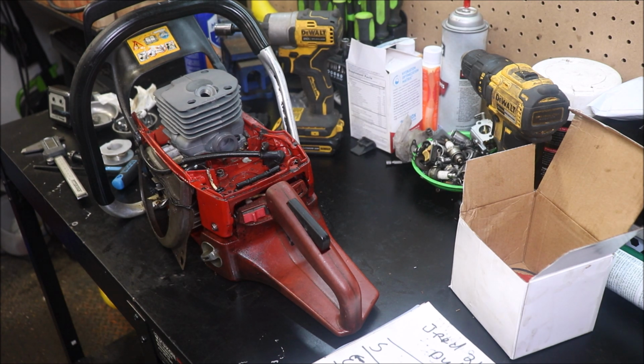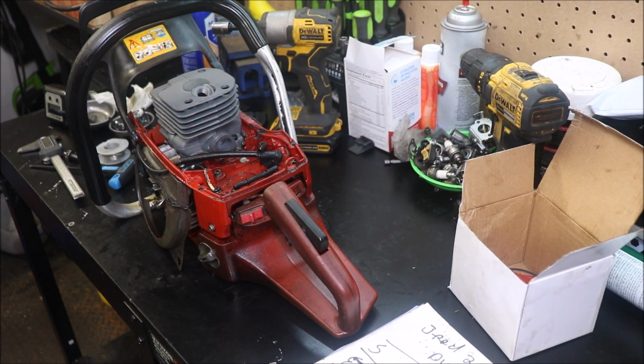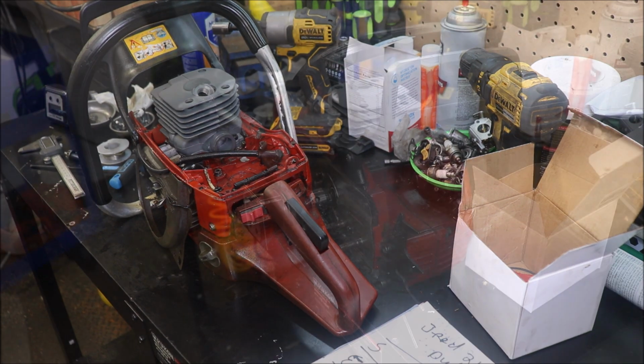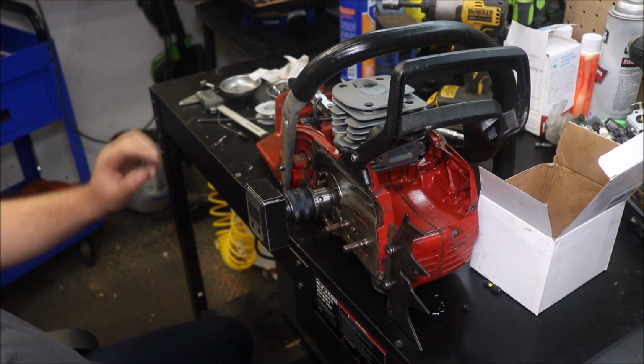Next thing I'll do, we'll get set up and see where the port map on this cylinder is at. Now, if you have an aftermarket saw, your deck height could be a little different than a set of OEM cases, but from Jonsered to Husqvarna, they're identical. They're made up the same. The crankshafts swap in and out the same. The same bottom end.